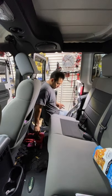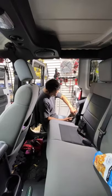Thoughts on silicone speaker baffles? All right, so let's think about that for a minute. Are we talking about the silicone speaker fast ring type things, or the baffles that go behind the speakers? Baffles behind the speakers I'm not a fan of. They're great if you're trying to keep rain off the speaker, like just a tube. But you need the back of the speaker open for air. If you close off the back of the speaker, you're going to lose all your mid-bass. But if you're talking about the piece that goes across the front like a fast ring, those are pretty sweet. Big shout out to those. Those are really nice.